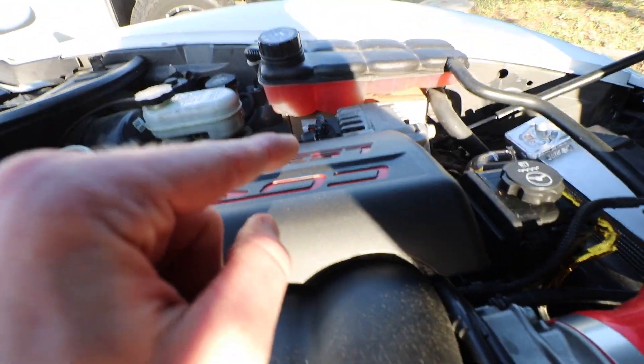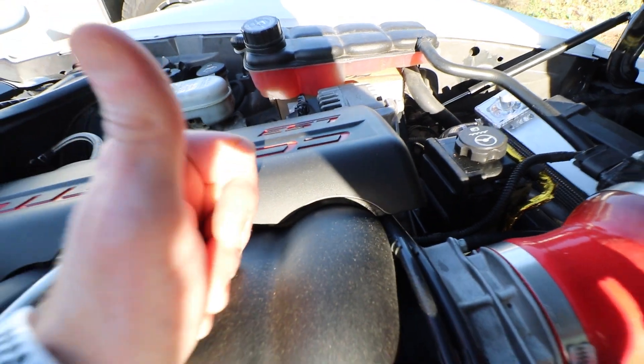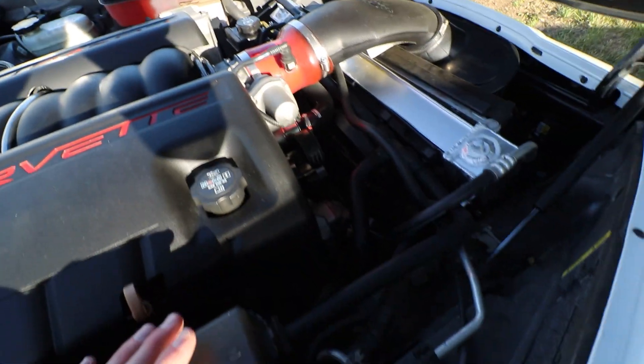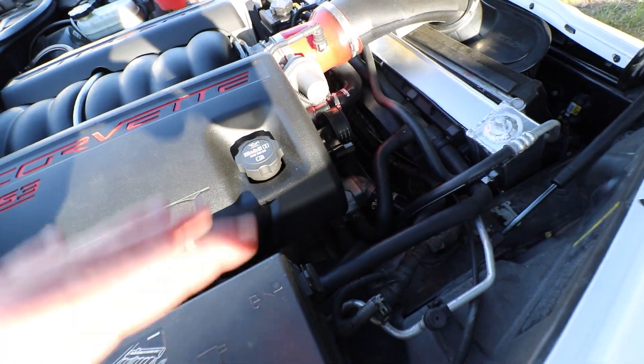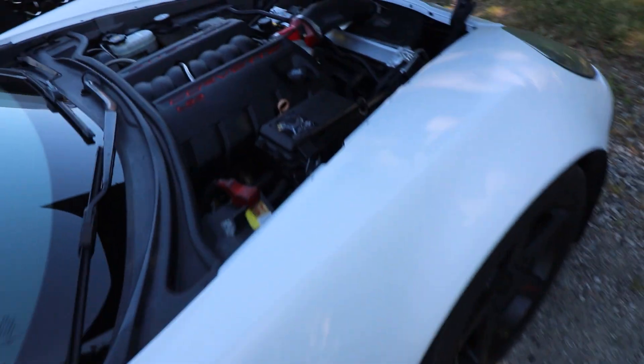She's warm — definitely toasty. That means the thermostat opened, which is awesome. So definitely if you're going to be burping it, raise the reservoir and that should solve your problem. You might have to let it cool down and repeat the process.